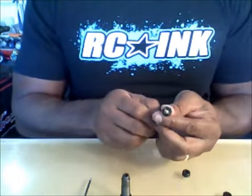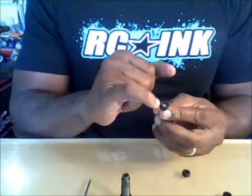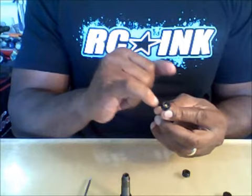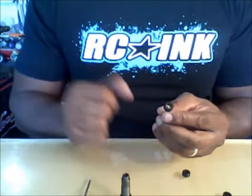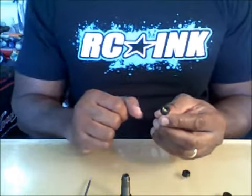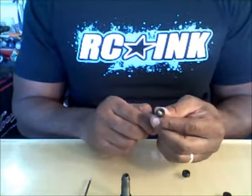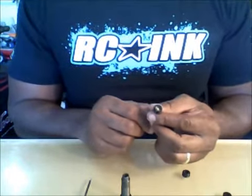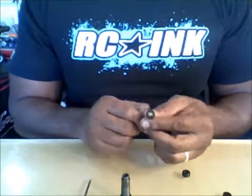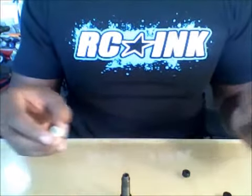Now, I also have a, you can't see on this video, but the inside of the piston has a slight radius in there to match the bladder if you run bladder style. If you run emulsion style piston shocks, then you don't really have to worry about it anyway. Most of us have to limit the travel on the shock to keep from bending out drives or breaking diff shafts or diff cups for that reason. And so there you have it, UFO pistons coming at you soon.